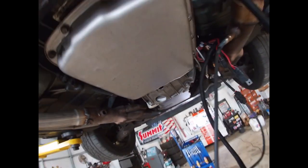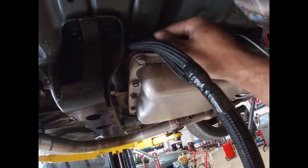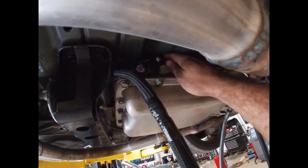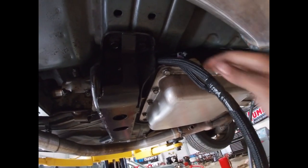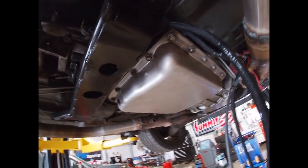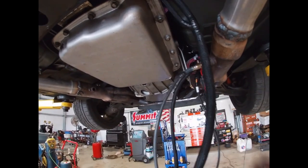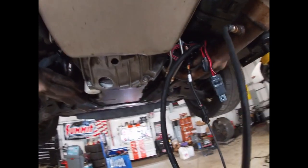The crank wire is hooked up right up in here — it's nice, it comes from Holley already heat wrapped, so that's good. Got the main transmission plug hooked in. This is the vehicle speed signal I still need to hook up so we can have a speedometer, but we've got the main connector hooked up and the tailshaft speed sensor plugged in. Once I get all these wires hooked back up and this relay mounted, it'll be looking pretty good.